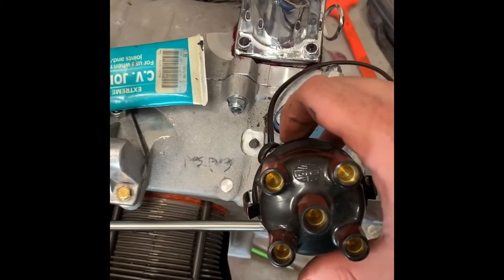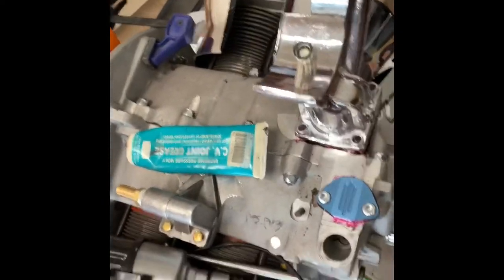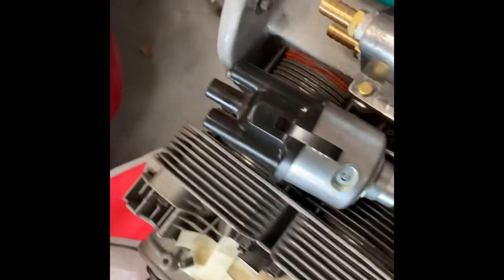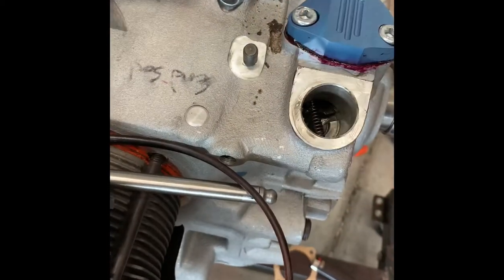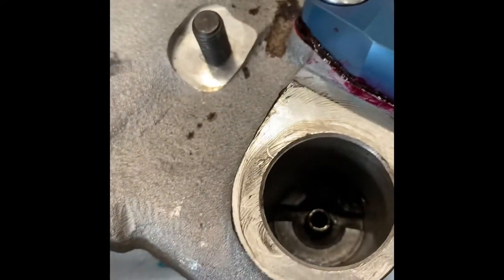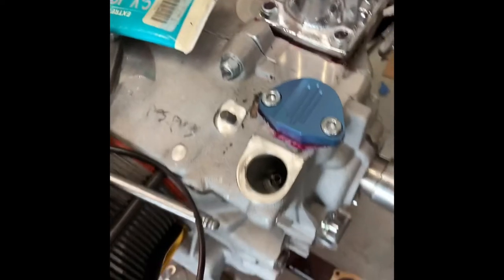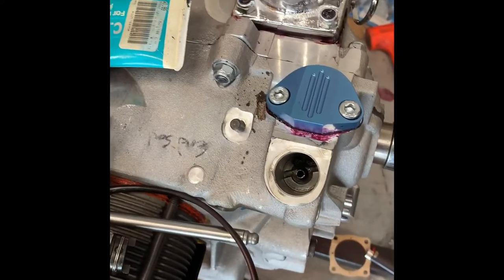Don't forget your distributor tie-down strap that goes here, and don't forget to put your spring in. Get a little grease on the spring and stick it in the center - you can see that little indent right there in the middle. It's a little tricky so you might need needle nose pliers to set it in place. You can see how it sits right there in the middle. Put a little grease on the end of it so it stays, then put your strap on. If you have any questions or comments, happy to hear them - thanks.